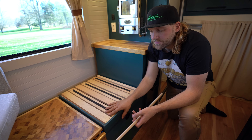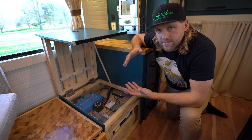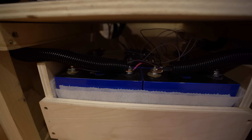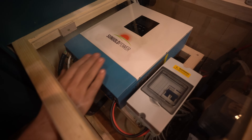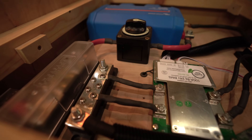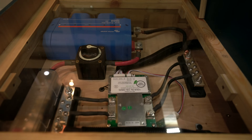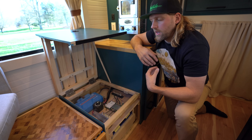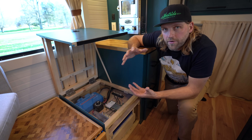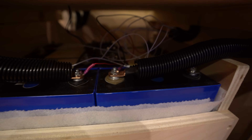Underneath the couch, you can lift each booth end to allow access to the power system. It's a 24-volt power system with a 24-volt battery pack. On the other booth end, we have our all-in-one, which is a solar charge controller, an inverter, and a shore power charger. On the board you can see the BMS, which manages all the battery cells, the main on-off for our power, and the Lynx distribution center, which sends power to different legs of the system. It's covered in plexiglass to keep it clean from dust and spills. The 1,200 watts of solar on the roof feed into our battery bank, which is comprised of eight 3-volt cells in series to make a 24-volt battery — a total of 560 amp hours.